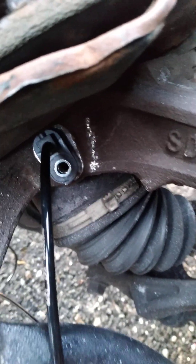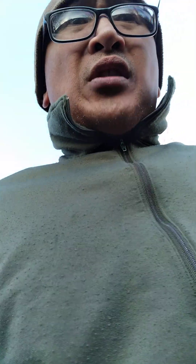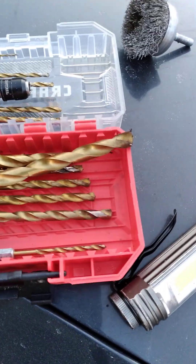Without removing everything, it can be done — but you have to have a lot of patience and hand skills, especially in the weather if you don't have a garage. I work at AutoZone or at my uncle's house in the driveway. This ABS system really gave me problems — you get a lot of jerking motion on the affected tire, and you might hear creaking and think it's a suspension component, but it's not. It's just ABS.